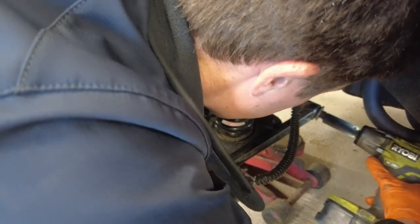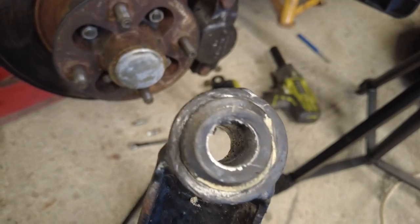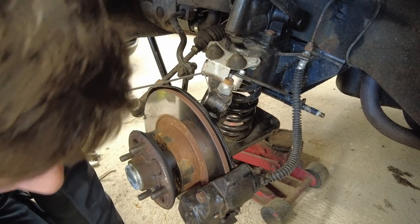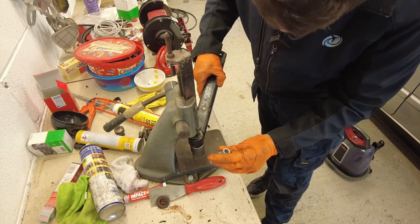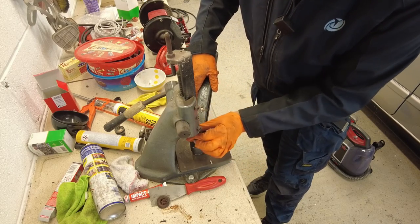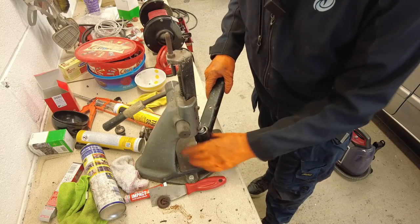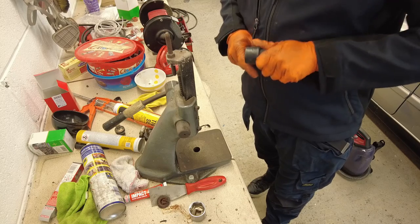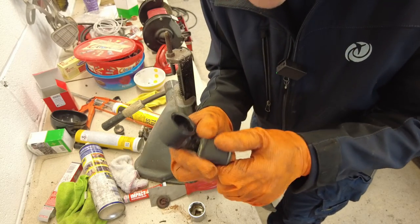There's that nut off - we'll get this one now. Let's have a look and see what we're dealing with here. It's gone very very spongy and very deformed. Let's get it over to the bench for a proper look. There are several ways to push bushings out without a press, but since I have one I'm going to use it. You could use a threaded bar with a socket, or probably knock them out with a hammer. These are way too pliable - they're spongy - so the car is never going to handle well with them like that.